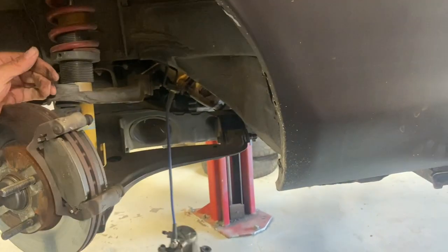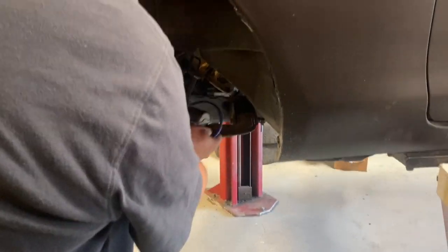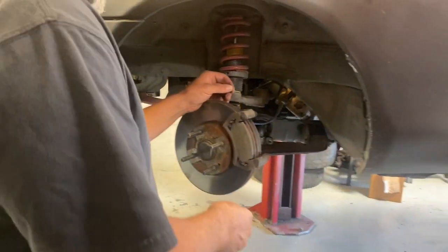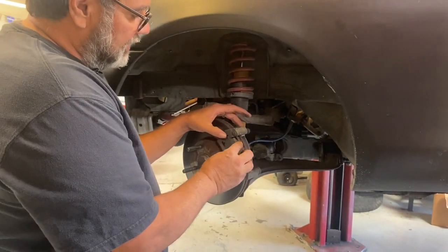Here's my top slider - it's in pretty good shape but it doesn't have any grease on it, so we'll take care of that in a minute. I'm going to pop the caliper off. I don't like to let these things hang - it's a little hard on the brake line - so I just set it on top of that lower control arm out of the way.